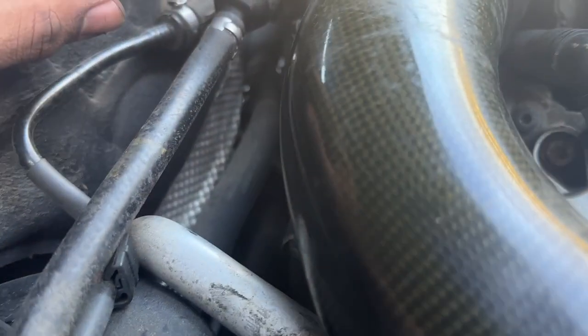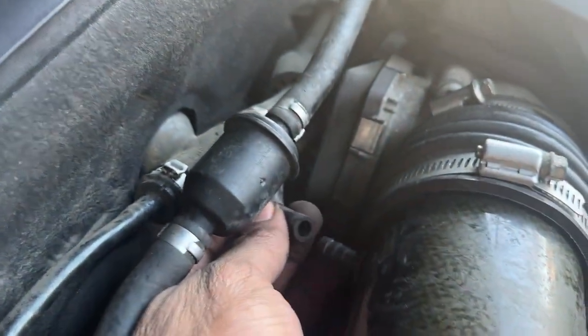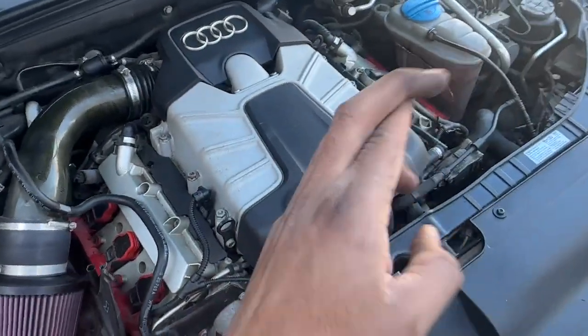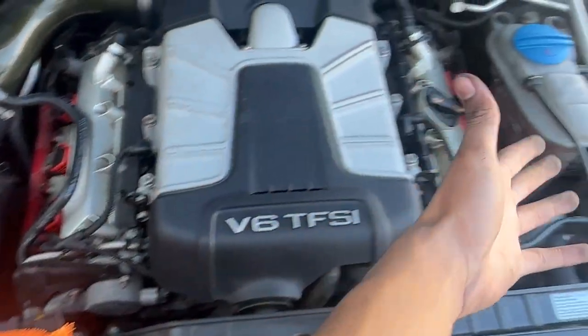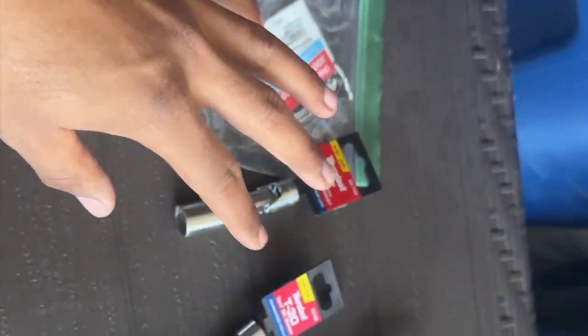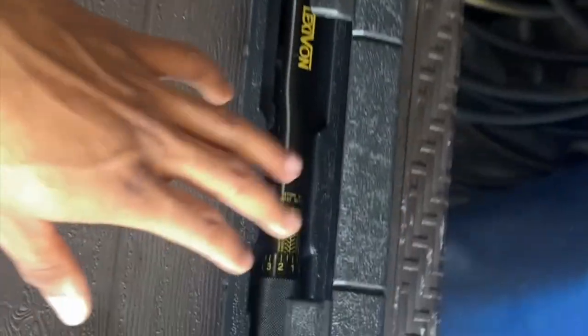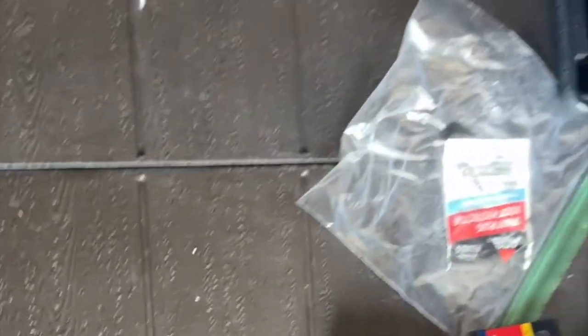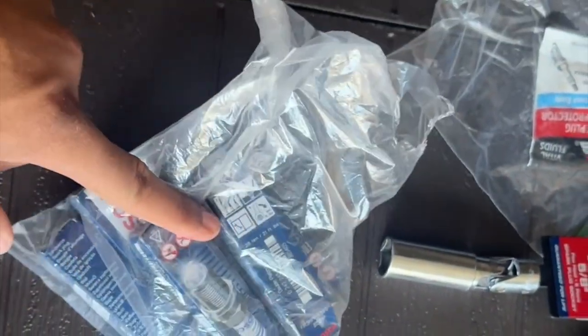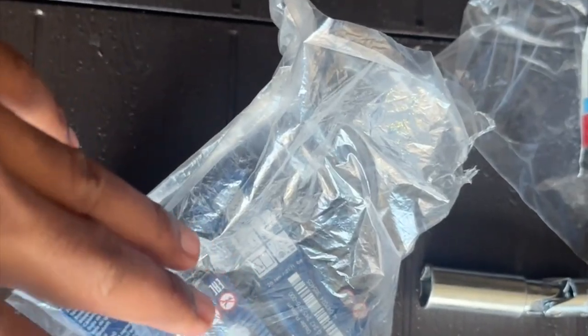All right, I got the intake back on, the reservoir back on and tightened down. Last thing is to make sure you put your vacuum line back on in the back - it attaches right here, slides on like that. Now just cross your fingers and hope you didn't mess anything up because there's a lot to undo. The car is working just fine. Tools you need: dielectric grease, torque wrench, 5/8 attachment, T20 Torx bit, 6-inch extension, and regular tools. Link in the description below.